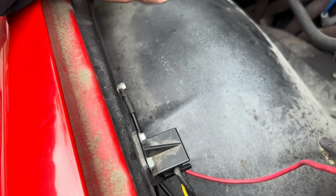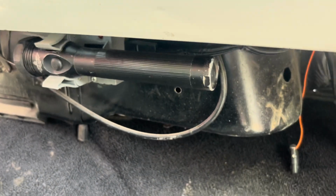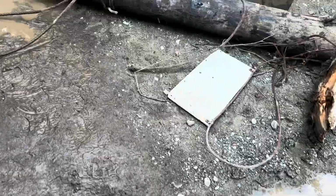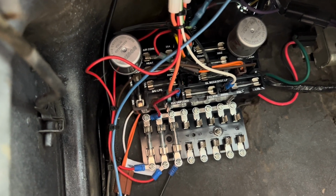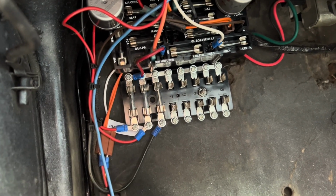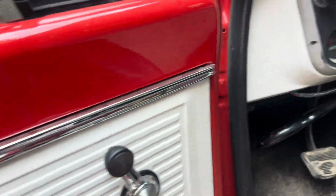It's fine. But anyways, I had these 2 wires coming in here. I could not remember what they were for. I followed them inside, and it's for the flashlight that I have in here. After I put this flashlight in, I added an aftermarket fuse box to my truck because I've added so many electronic things to it. This little guy under my fuse box looks like a nest, but honestly, that's not that bad. That's fine. I added that because I have more fuses, so I don't have to splice into stuff. So what I'm going to do is run the wires from that flashlight over to here.